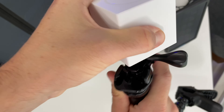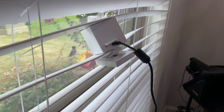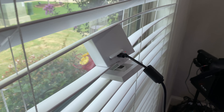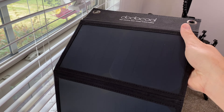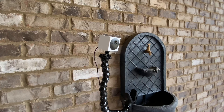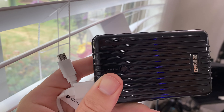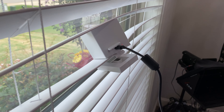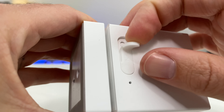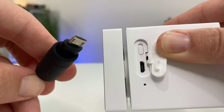I'm also a fan of solar panels, and it makes sense to have one available for a wireless outdoor camera like this. I tried testing two different panels I had on hand, and it was pretty strange. At times it showed the camera was charging successfully, but if I left it on for longer periods the battery percentage sort of dropped. I have a suspicion that Wyze is working on something official, but nothing out yet. They even say in their FAQ that the camera will function while charging, however this is not recommended as the camera is built with the intention of running primarily off battery power. Also keep in mind, when the camera is plugged in the weather seal is broken, which could possibly cause issues if exposed to moisture.